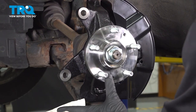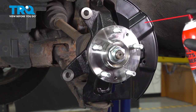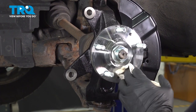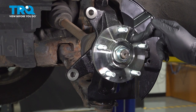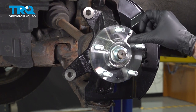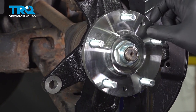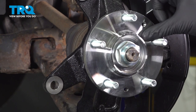Now we're going to clean up our hub surface here. This hub surface is extremely clean, but I'm going to hit it with some brake clean and get rid of the greases. Now if your hub surface was old or corroded, this is where you'd want to come in with either a wire brush or a small abrasion disc and clean up in between your lugs. You want this surface to be as flat and as smooth as possible. What you do not want to do is grind this as flat as possible — you don't want to remove material. You just want to get rid of the old corrosion, if there is any.